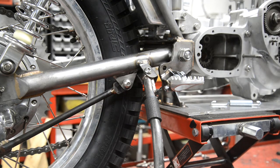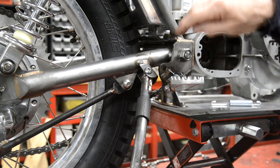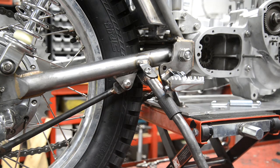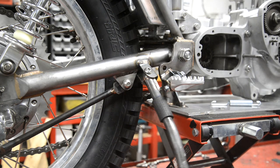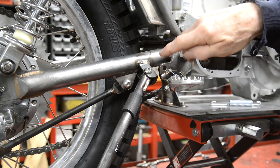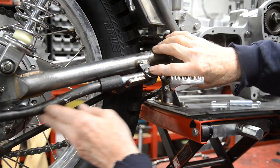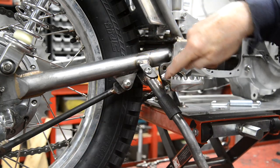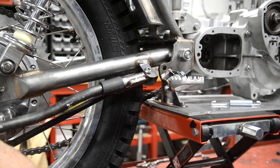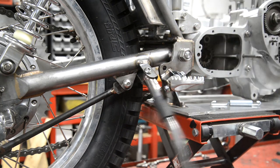So what we want is a spring, and I don't know if you can see, I've marked it up here. Basically, the way the spring on this is going to work is that this is going to be, say, 110 or 100 degrees. So basically what we want is that when this is at 50 degrees, or whatever the theoretical number is, we want a pin there and a pin here in a straight line through that. And that means that when it's up there, it's going to be offset, and when it's down here, it's going to be offset from the center line. So the spring will be holding that up there, in tension. And then when it comes down, you'll be stretching the spring because you're getting to a wider part of the arc. And then when it gets around here, because again it's gone off center, it'll pull it and hold it there.